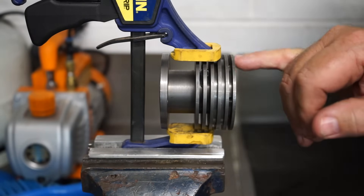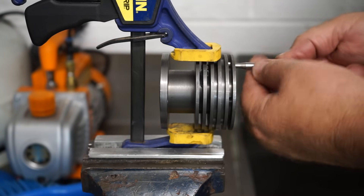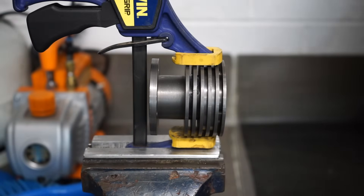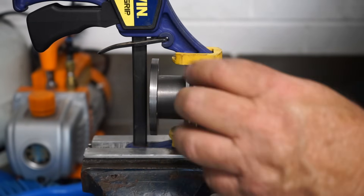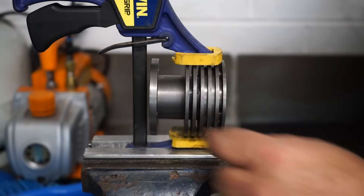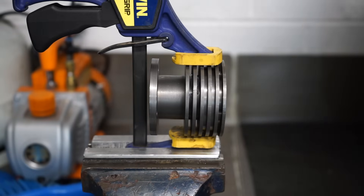I was a little bit worried that the thread might have been stretched. This is my tap and it still feels relatively good and tight in there — a little tiny bit loose, but I think it's good enough for government work, so to speak. Off camera I mixed up some JB weld and stuck these broken pieces of fin back together — it actually broke in two pieces, so I've glued both smaller pieces together, then glued the large piece as a whole back in with JB weld. I've got a clamp on there with just a little bit of pressure and I'll hold that for 24 hours.